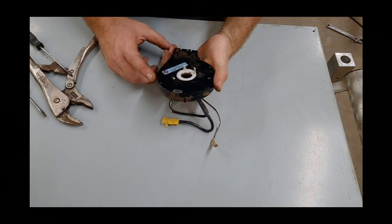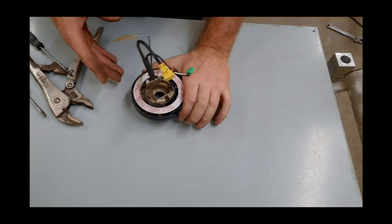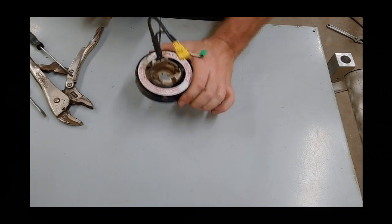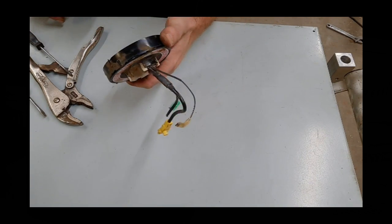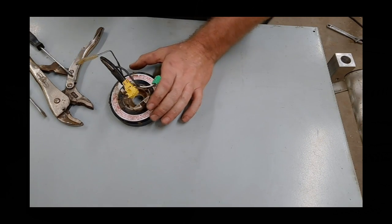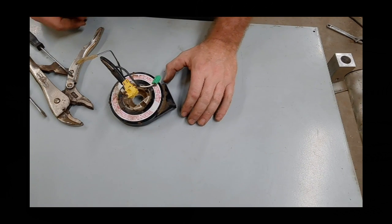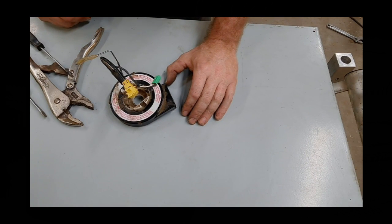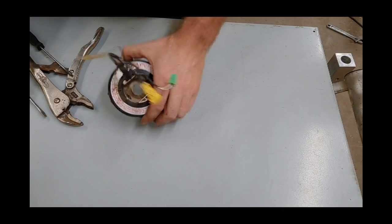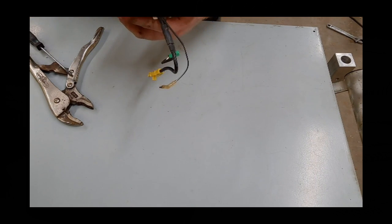Since we're interested to see what happened to the old clock spring, we're going to try to take it apart. The issue is that it has small Torx bolts around the outside — looks like probably at least a T5, and the smallest I have is a T10. I couldn't find anything to fit those Torx bolts that small, so we're going to take it apart the less graceful way — with some screwdrivers, some pliers, and if needed a hammer.